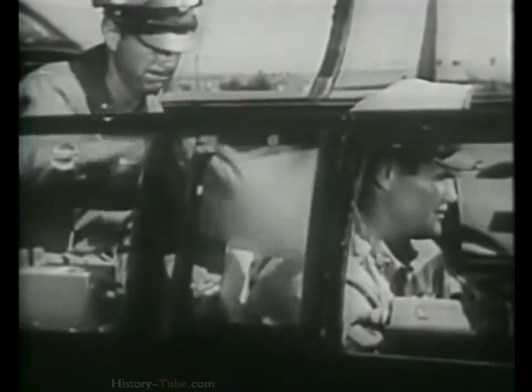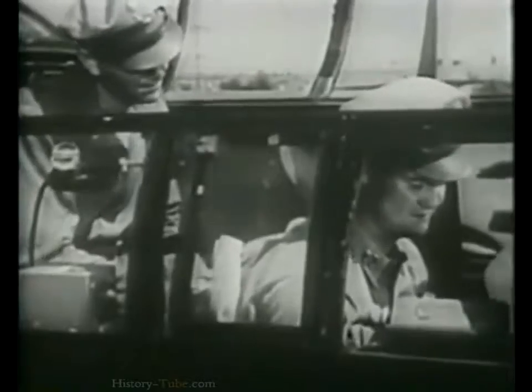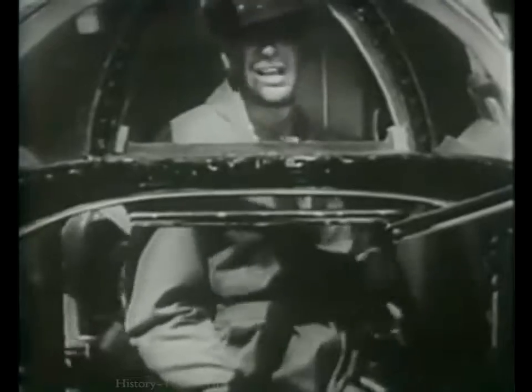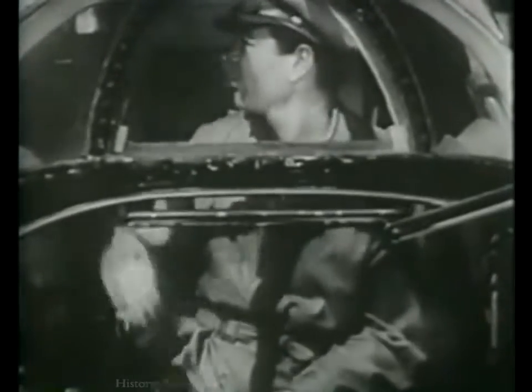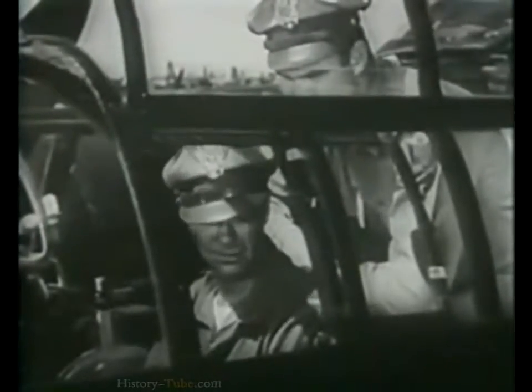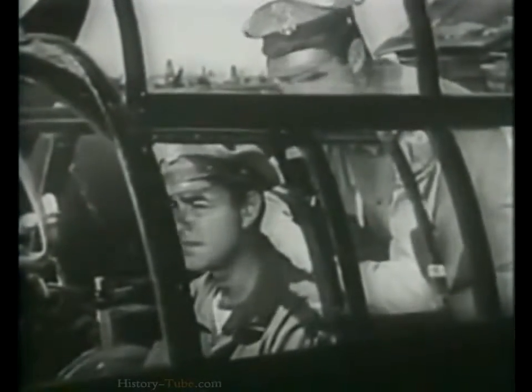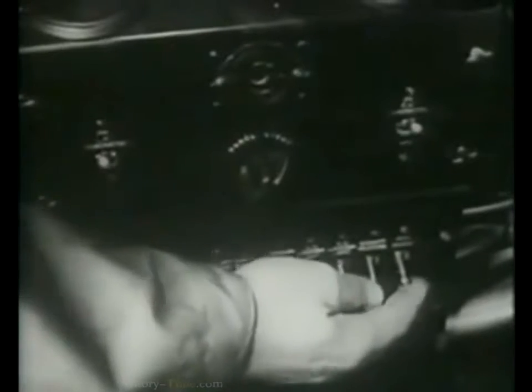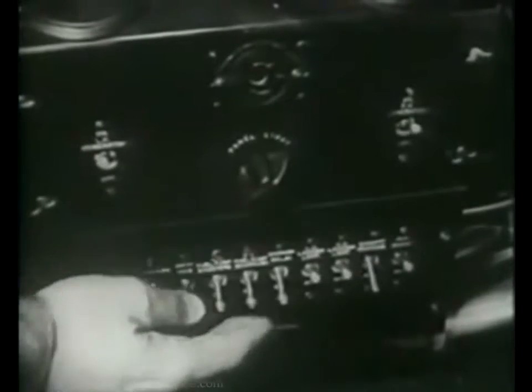Here's an old story, but a wise one: Form 1A. Check and sign for red diagonals. Turn on the circuit breakers behind the gunner's seat. And make sure the gunner's escape hatch is closed and locked. From now on, you are in command of the airplane. You know the answer from studying the tech order: turn on the generators, then more circuit breakers — the ones for the starters, fuel booster pumps, and the light circuit breakers.